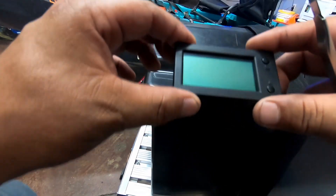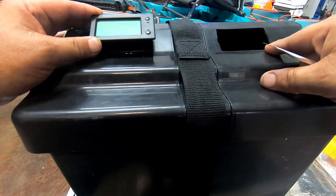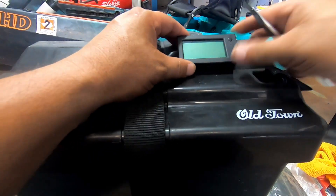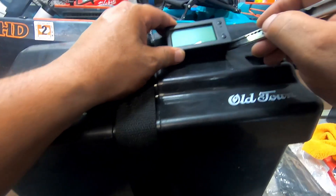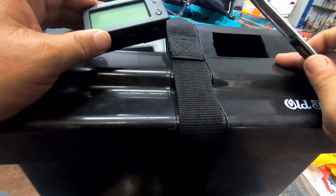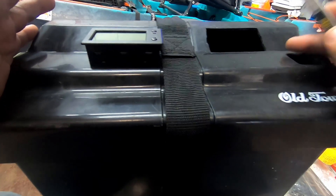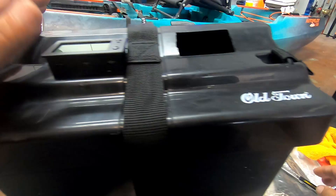The first thing you want to do is determine where you want to place your multimeter display. I ended up cutting it out right here. At first I was going to put it here, but after looking, the positive cable was on this side so I ended up placing it here. I mocked it up and scored it with my box knife. This plastic is pretty soft — I was going to use a dremel but there's really no need for it. You just score it a couple of times and it pops right out.